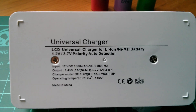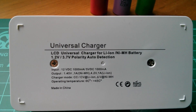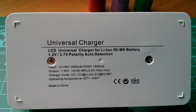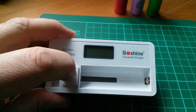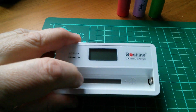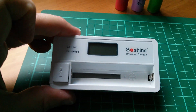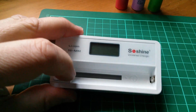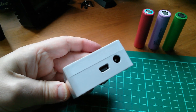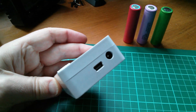It doesn't appear to have temperature sensors, so it's not going to be the perfect charger for nickel metal hydride, because you really want to be measuring temperature and also have a timeout. Operating temperature is 0 to plus 45 degrees. On the front you've got a sliding negative connection to accommodate different length batteries — it sits in a ratchet. At full extent it'll take 18700 cells, which are 70mm long, or 18650s by pushing it back a little way. On the end there's a mini USB and a 2.1mm 12 volt jack.